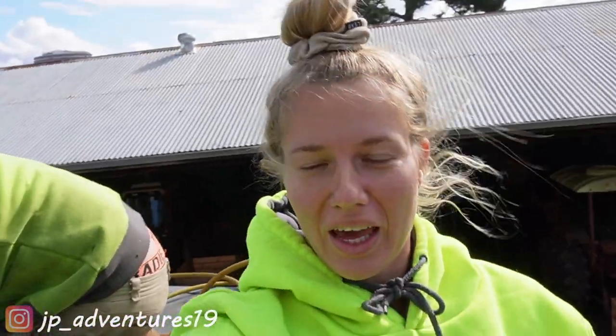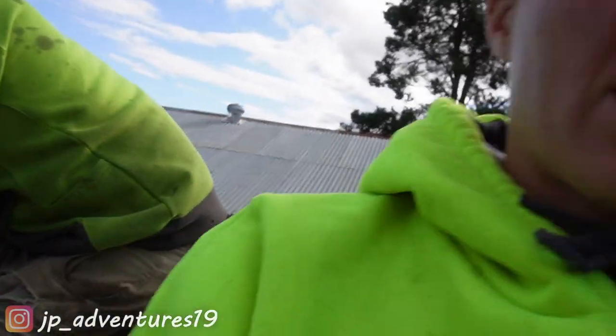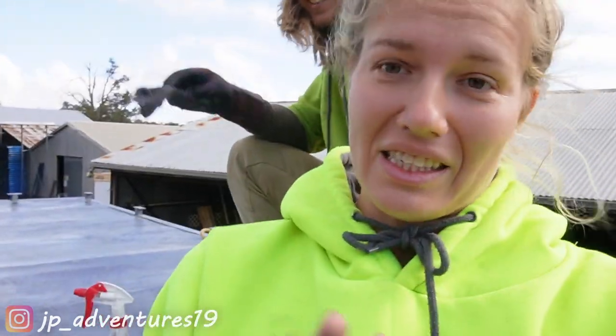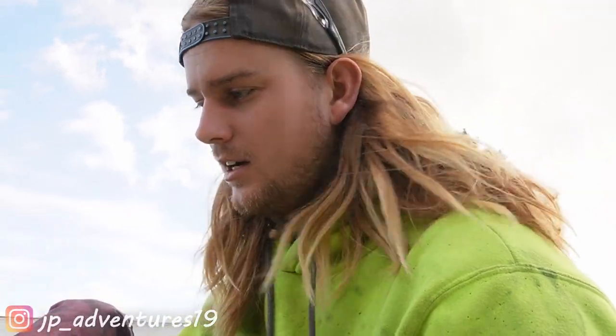All right, we're up on the roof cap and the roof of the box. Over time there was rust forming on our roof — this is what it currently looks like. We actually don't know exactly what caused it; if someone out there has an idea or wants to tell us how to prevent rust from forming under the paint — because it's forming underneath the paint and then coming through as shiny spots. Everywhere there was a shiny spot we took away a large amount of material just to make sure we got all the rust.